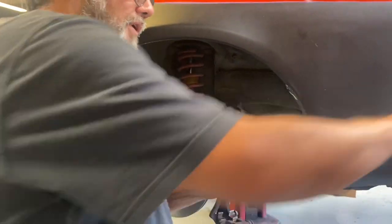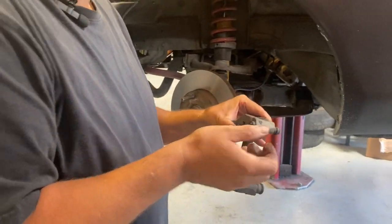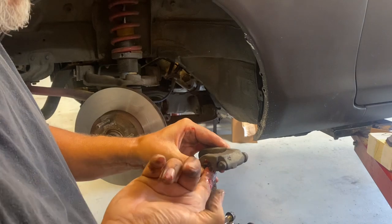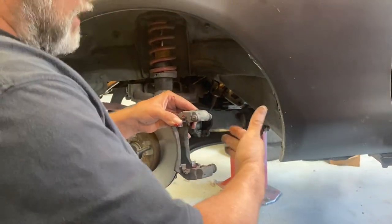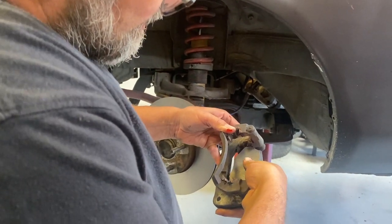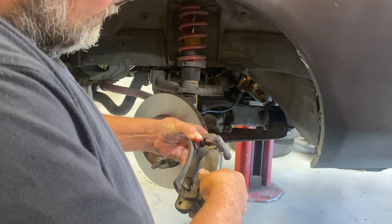The top clips are a little trickier because gravity isn't your friend. This one goes on this side - I'll put a little grease on the back side of it to hold it up, then set it in there. Put a little grease where the pad slides. Sometimes people put the pads on here while they're putting this on - either way is fine. Make sure you put the brake lining towards the rotor - don't get it backwards, or you'll end up running metal to metal right off the bat. It's kind of difficult to get them lined up this way.